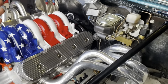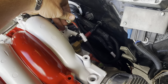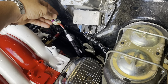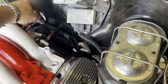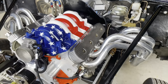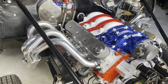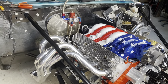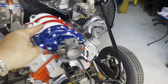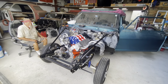The only thing left — the MAP sensor I had was a truck MAP sensor and it won't fit in the back of the intake. I tried to cut it and make it fit and I ended up breaking it. So instead of breaking another one, I'm just going to order the right LS1 sensor. My buddy Tom said he's got an LS3 — I don't know if it'll fit the intake but we'll see. Other than that, we're making a little bit of progress. I'm going to keep working on the wiring; I've got to get the ECU mounted and all that inside. I figured y'all wanted to see the intake on there because that thing is just absolutely killer.